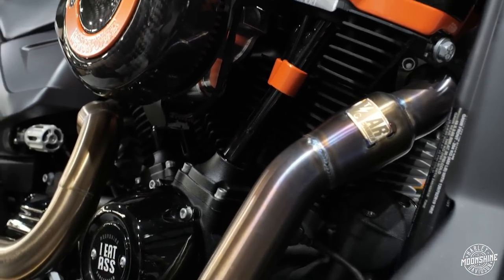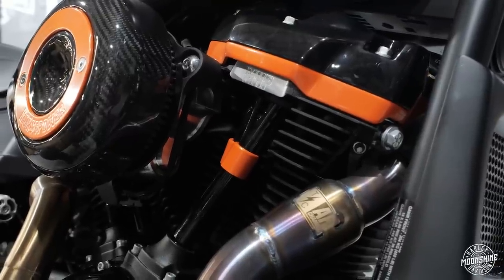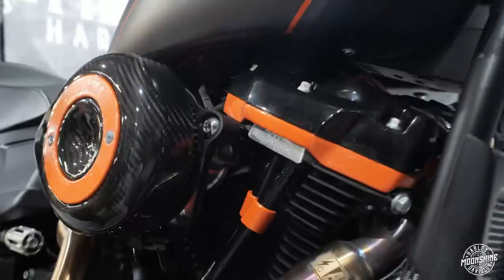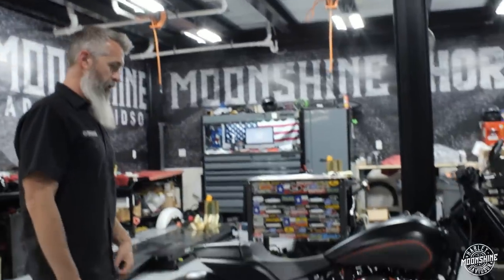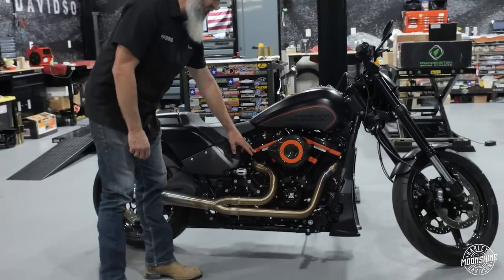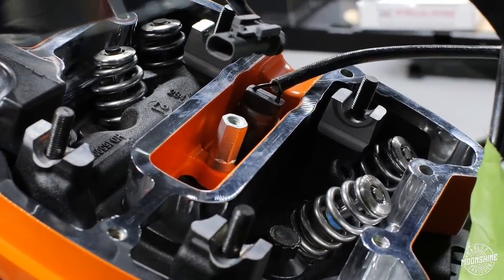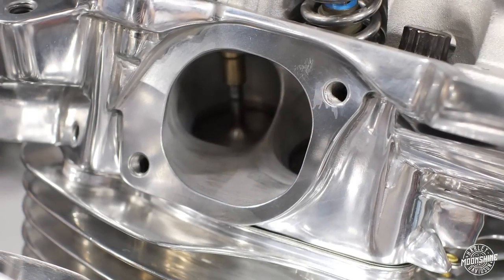Anodized jugs — that's something we have to do before we actually sleeve them. They look beautiful on there. We just want to make sure that the hard anodized is able to retain its color after she heats up and cools down, takes the abuse of the sun out there. So MHP CNC Game Changer cylinders, anodized black. It's got a pair of our monster heads on it, which are going to be the plus 2.5 millimeter oversized valves. They are titanium with Inconel exhaust. They run our big square port intake runner.